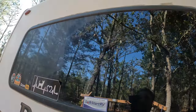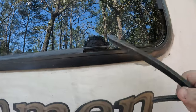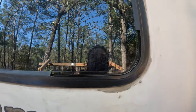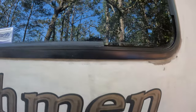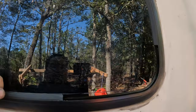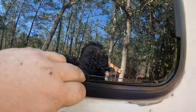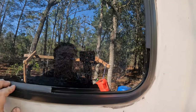I cleaned this window area and wiped the whole trim down, then removed the piece. You want to try to make sure you get your cuts as straight as possible so it looks good when you match up the caulking. I wiped everything down with Windex and made sure to get in the track so you have a nice clean area for the stuff to apply to. You want to apply the caulk right down in here - they say use a three-eighths inch bead.